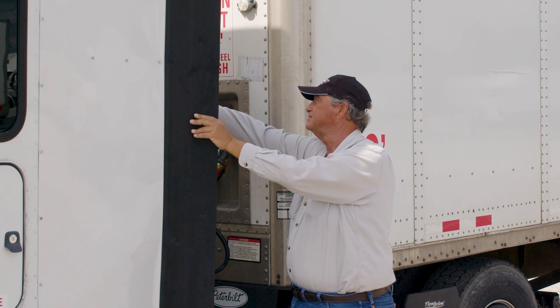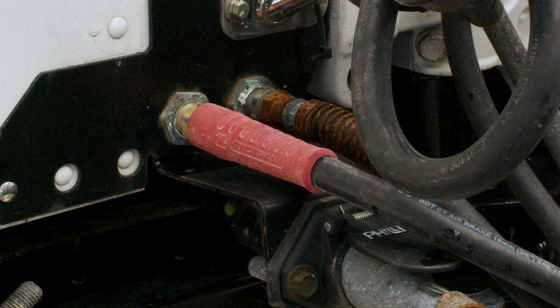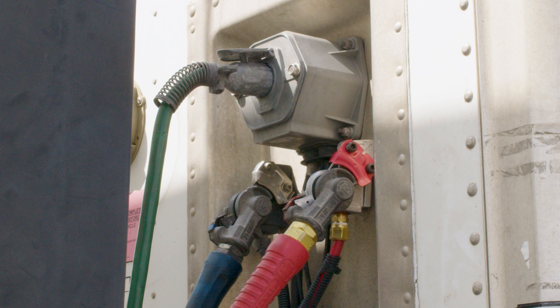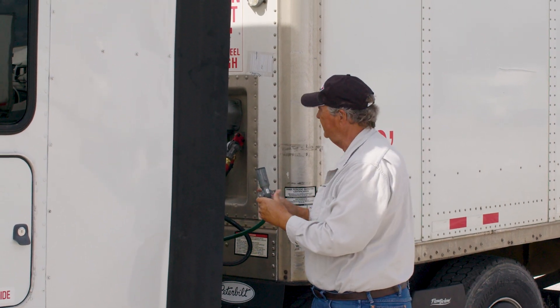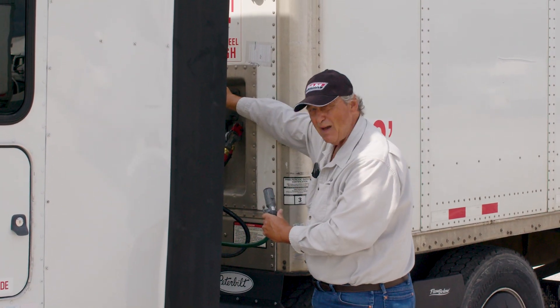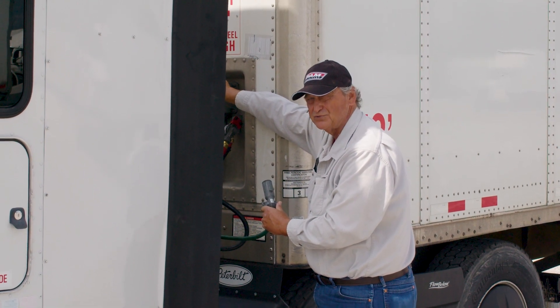At this juncture, you're going to look at the back of the truck. You're going to see that it's got reflective tape, which is required at the two top corners. You also have work lights and your air system here. The air lines need to be properly secured — they must not drag on anything, must not sit on the catwalk or drag on the fuel tanks. Make sure there's no chafing, no bare wiring, no holes or cuts in these air lines. You have your electrical box here — this puts the electrical power from the truck into the trailer for the lights. It must be clean and secure. There should be no missing or broken pins from the power box.